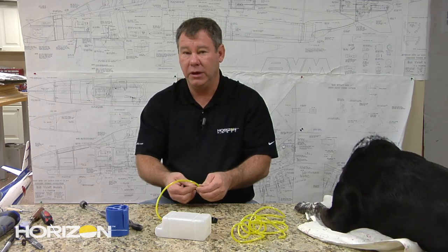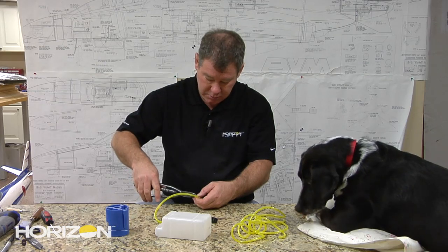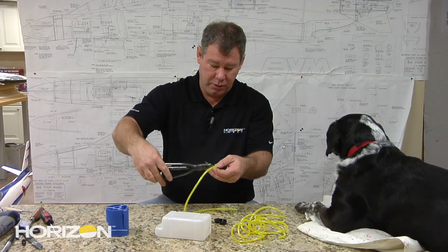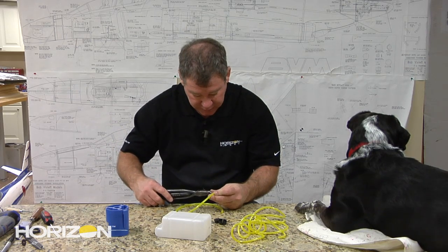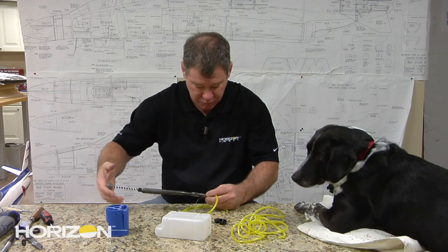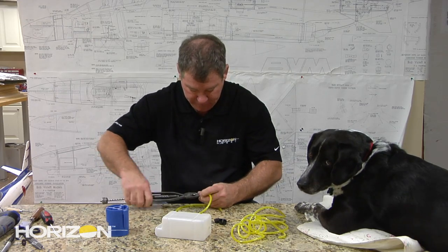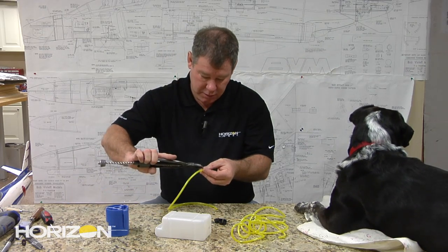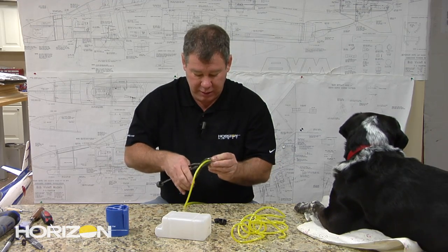You can spend anywhere from $20 to $200 for a set of safety wire pliers, and they make safety wiring substantially easier. As you can see, it's open. We're going to put it here on the wire, and as we clamp it down we lock it in place. We get the wire where it needs to be, and then you pull the end and it twists the wire. Clip it off, and then you kind of loop it back over itself so that wire doesn't get a little pokey.